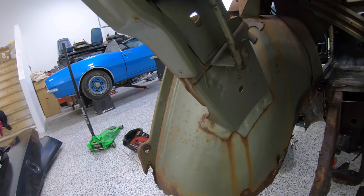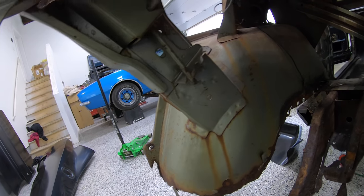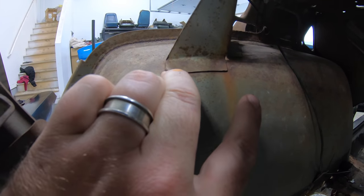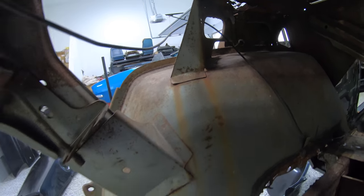We'll clean them up on the backside with a nice flap wheel. So, you know, not a whole lot of grinding involved there. But the same thing here, you can see this corner right here is lifted, for example. Drop the air chisel right underneath that. It'll peel up like a tuna can. So let's go ahead, let's grab some tools and let's get this wheelhouse out.